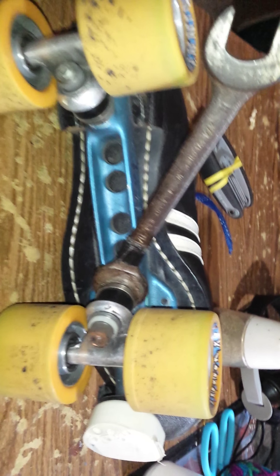First you're going to want to break this nut loose right here. Now this is normally an 11 sixteenths, but you have to use a wrench that has been ground down thin to get in there, because that's a super thin nut. So we break that loose.